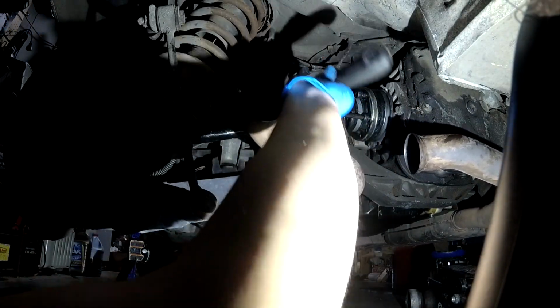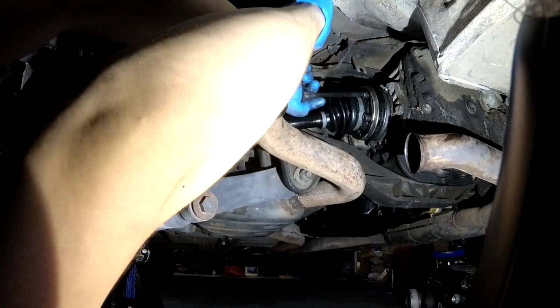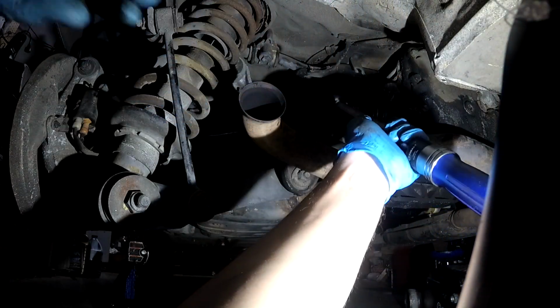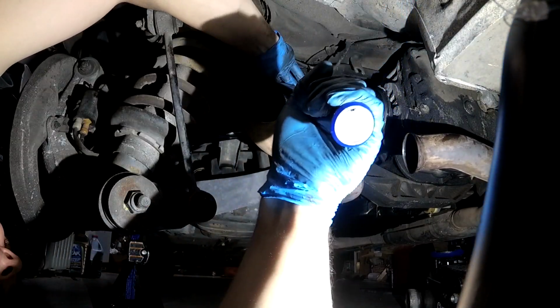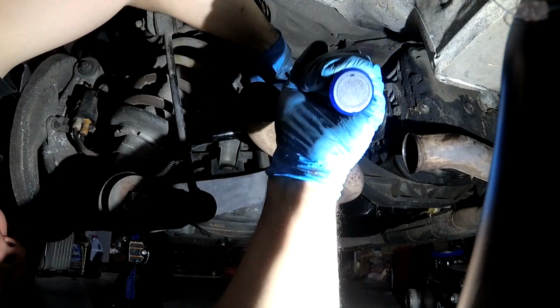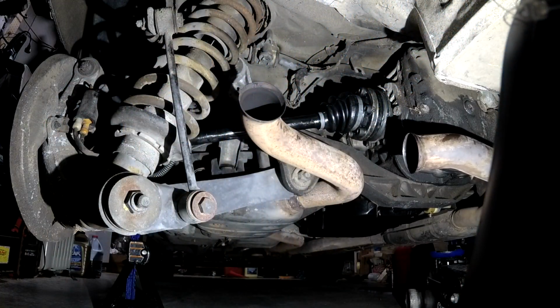There we go. Alright, parking brake is set, so we can tighten these to spec. And no matter what anybody says, it just flat out is not true that a longer bit like this will throw off the torque spec. Because, while yes, it may deflect some, that torque is still getting transferred to the bolt. It's not escaping. If this was an impact and it was doing a bunch of successive hits, that would be true. That's how torque sticks work. But by hand, it just isn't how it works.